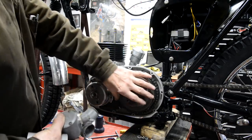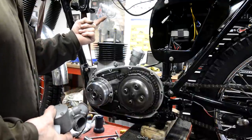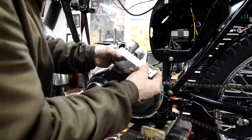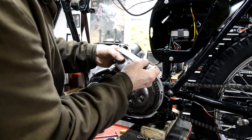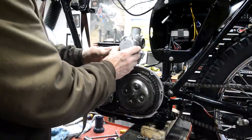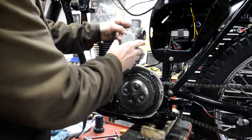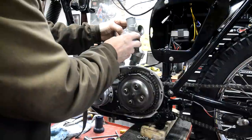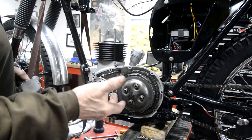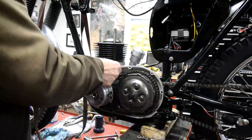But I have got this apparently high compression piston, the head's got the bigger valves in it, and now I find I've got a larger carb; for the C15 Star it should be 7/8. That's 1 1/16. That is the size for the US spec Sports Star. So it's all very confusing. But anyway, I'll have to make up something now to go from there to there, because I'm going to use this carb. I've got a rebuild kit for it. And the slide doesn't seem to have much play in it at all. I think it'll be fine. And as somebody mentioned in a comment, I thought this was going to be a low-cost job. Well, as I mentioned before, they never, ever are.